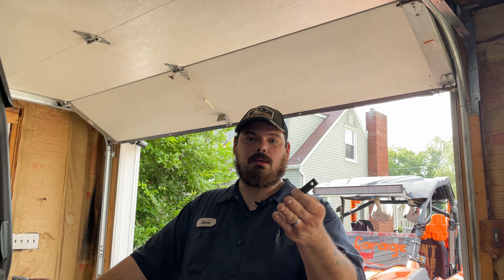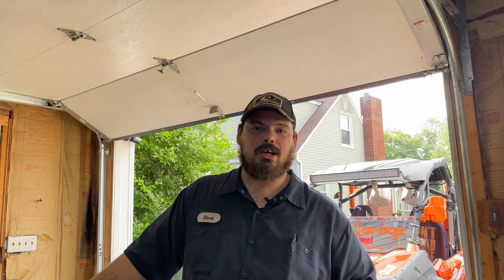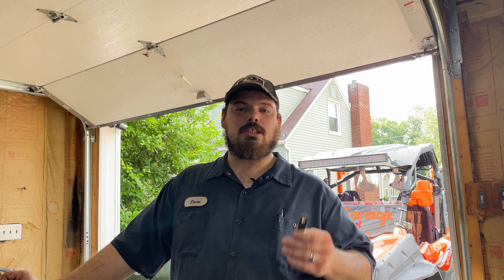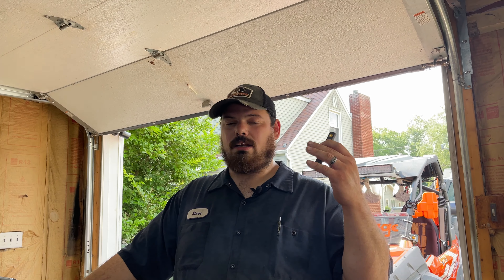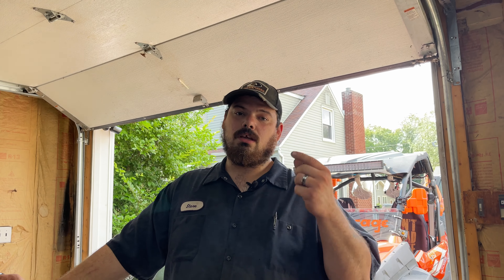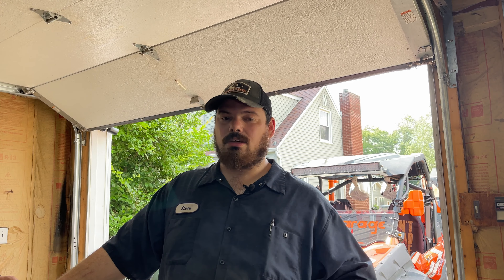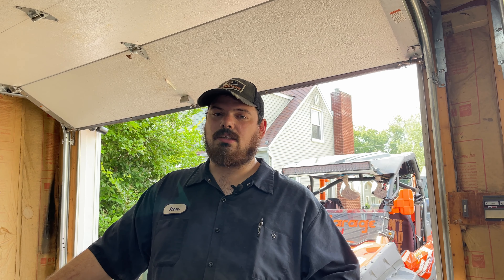His battery went bad and I said, why don't you spend a couple extra dollars and we'll relocate the battery to where it's supposed to be anyway. That way, if he ever has to change his belt on a trail, he ain't got to deal with it in the way. Eventually we could get rid of that little shelf the battery sits on, or you can add two batteries using this method too. We're only going to keep one and it's going under the seat, so we can clean the mud out easier, check the belt easier, and do all kinds of things easier.